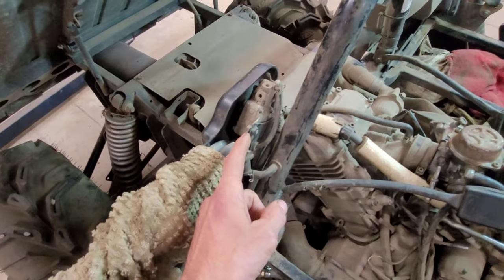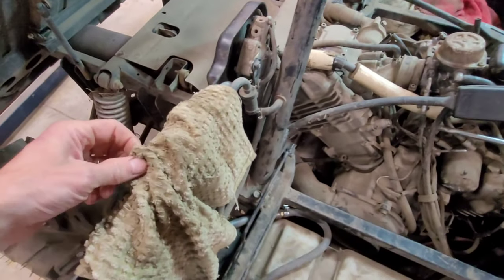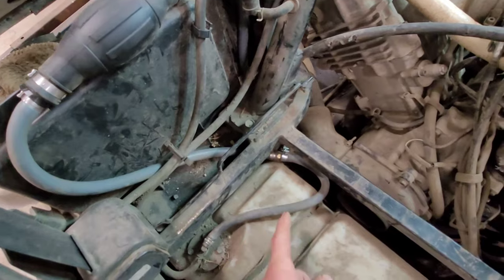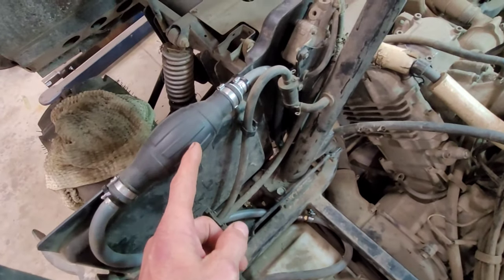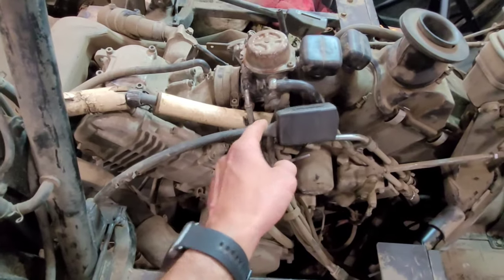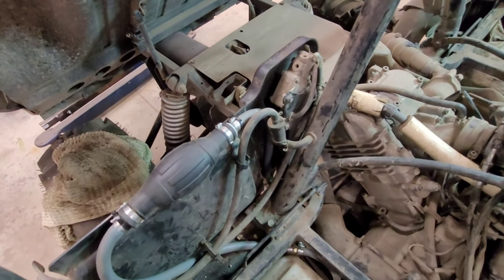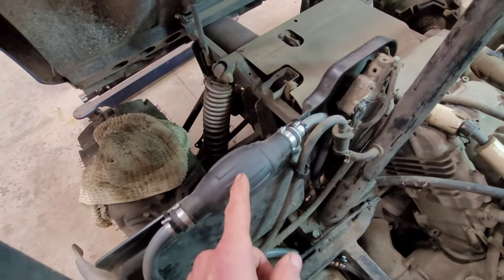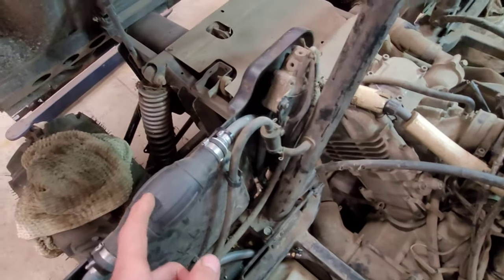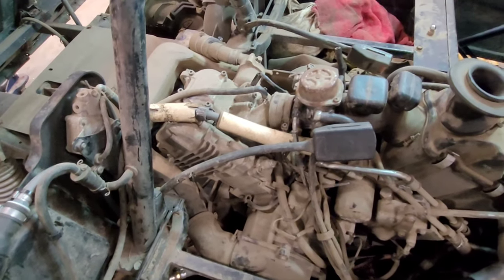If that still doesn't work and you know that your pump is good, you can do what I did. I simply added inline a primer ball just like you see here. It comes right from the tank, inline, goes through the primer ball, down into the pump, which pressurizes through the pump and fills the carburetor bowl down here. This also does one other thing — if your bike hasn't been sitting for too long, you have a reserve of fuel right up in this ball, so this pump doesn't have to work half as hard to draw fuel from the tank. Rather than that, it'll draw it right from here.